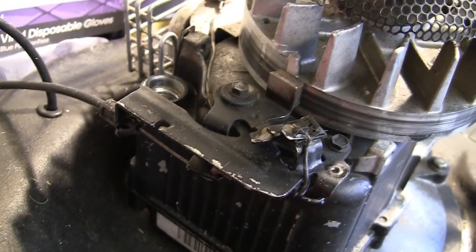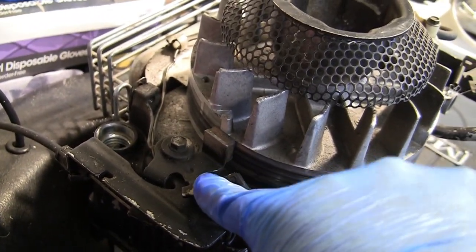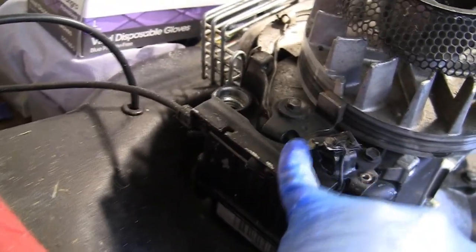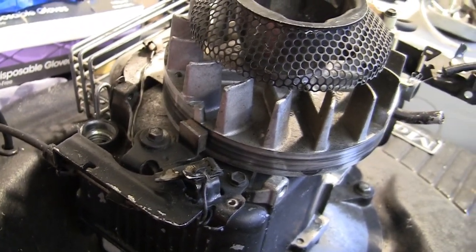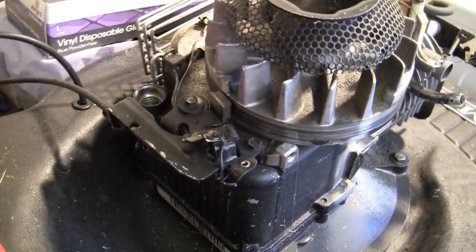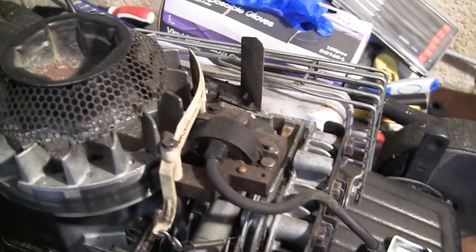Pull this handle and make sure you're getting a disconnect between these two parts of the kill switch. This mower isn't brilliant for showing it, but the little tab on top has to disconnect when the handle moves. If it doesn't move out of the way, you will get no spark to your spark plug. So make sure that's clean, make sure when you pull the handle these two parts actually disconnect. Also, when putting the recoil cover back on, make sure you don't accidentally split this wire, and make sure it's connected underneath the coil — especially if you've had the ignition coil off.